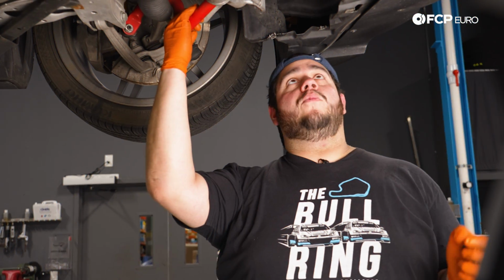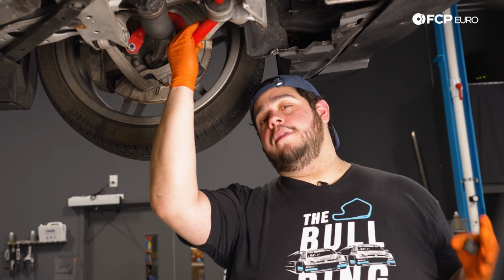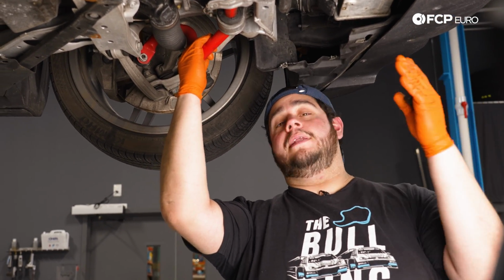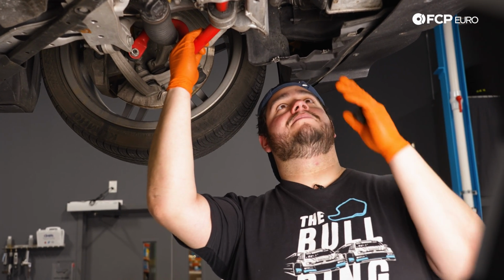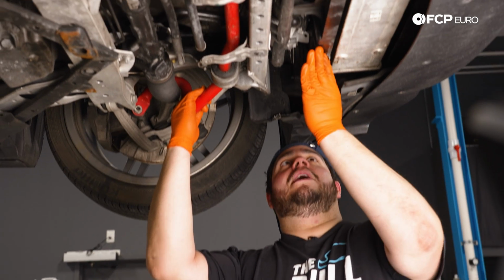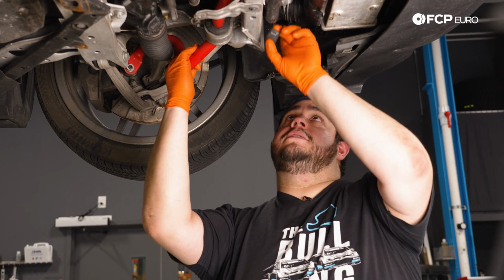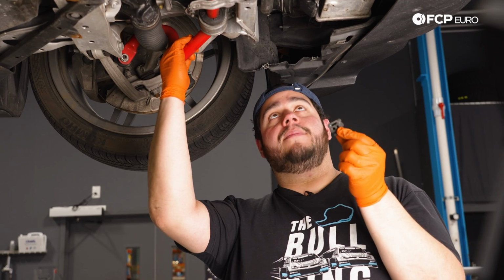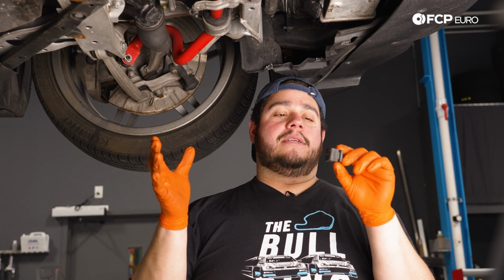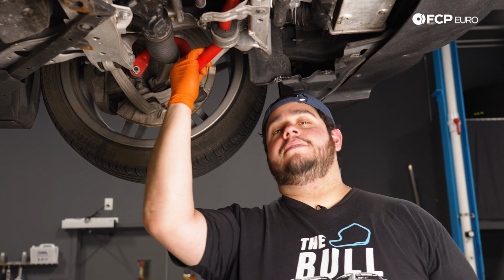My good people, one good thing to note, and this applies to any aftermarket part that you're installing, especially if it's an upgraded part, a little bit bigger, wider, thicker, whatever it may be. One thing to note is that the packaging, which is already tight, for example, on an N54 car, can get a little bit tighter, meaning that sometimes things can fit a little bit differently than when they were in there with their stock counterparts, meaning maybe this fan shroud changes a little bit in its positioning against the radiator and intercooler. In our case, what we were fighting with this driver's side charge pipe is this rubber bushing. You saw me point this out when we took the fan shroud out earlier. And it's just a little bushing that sits on the fan shroud, and the factory stock charge pipe kind of just bites around it. Kind of keeps it from vibrating or rattling up against the fan shroud or moving around a little too much.